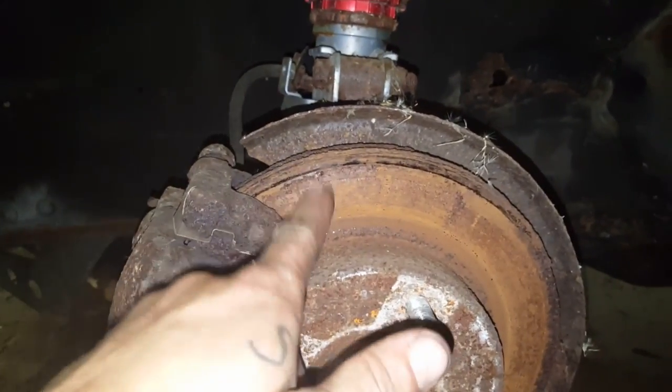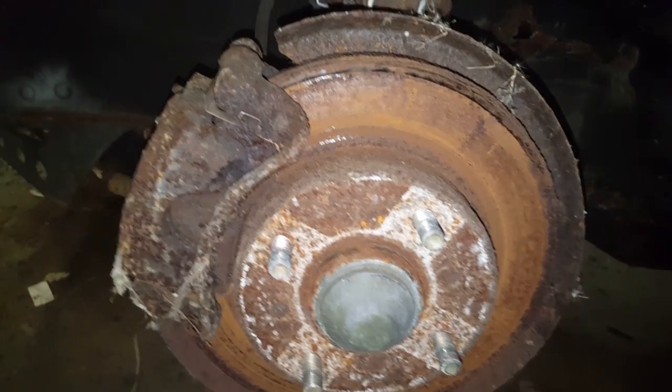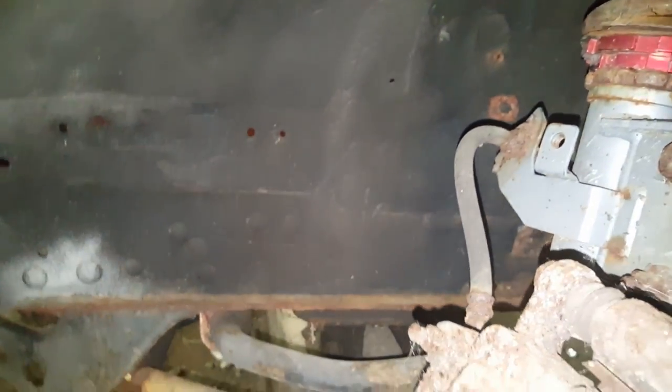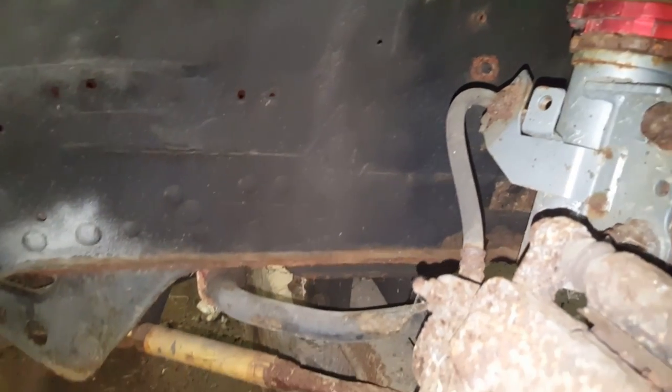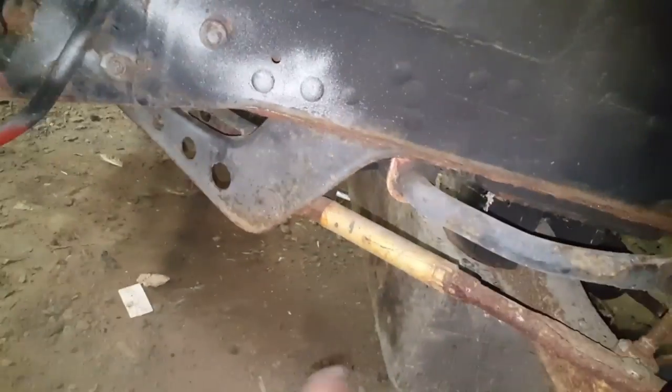So what I was saying is — I'm going to take these rears. They need to be replaced. I have brand new drill-slotted rotors that are four lugs drilled to five from the factory, and I have Z32 brakes we're going to stick on here — a big brake kit. I also have braided brake lines to put on here. We're going to take all the suspension off, respray all that. The A-arms we'll respray, and we'll put new tie rod ends on it probably.